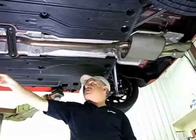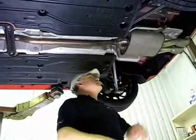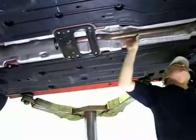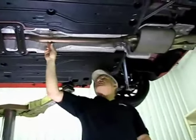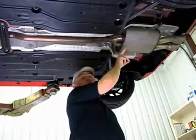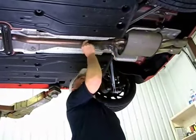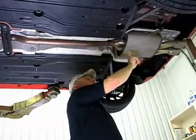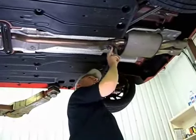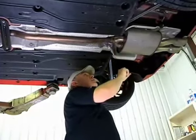It's a pretty straightforward exhaust system. It runs right down the center of the vehicle out the back. It has a single muffler in the rear and a resonator up front. What's interesting about the system is the center pipe goes into a Y connector, and then the muffler is two in and two out. I don't like that design. On the Supersprint, we've got a better design where we're going in with two, and there's a larger Y section inside the muffler that splits out into two, giving you a little bit more free-flow Y characteristic right out the back of the vehicle.